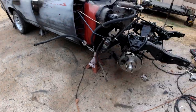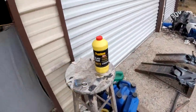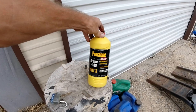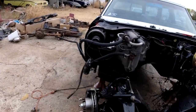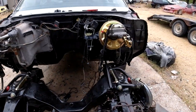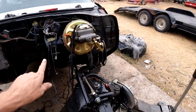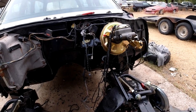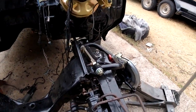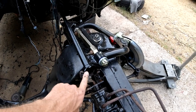I think that's it for the brake system. It's got some new fluid - we'll fill her up with fluid and see if anything leaks. I'm a little bit worried about these flares, whether I did them right or if I got to do double flares. The rag joint should be in any day now - we'll put that on.